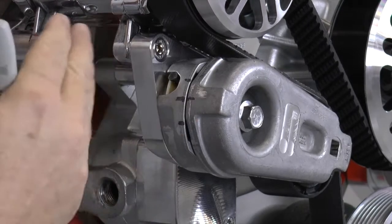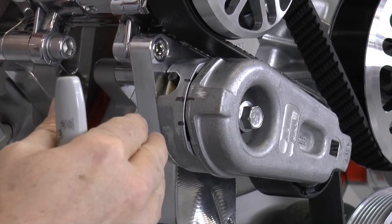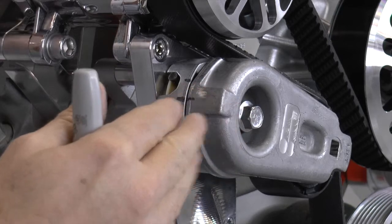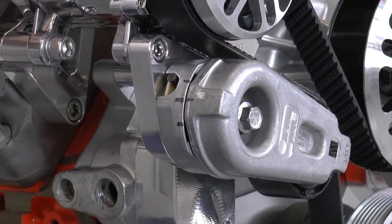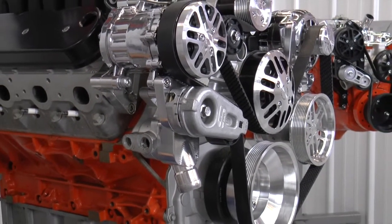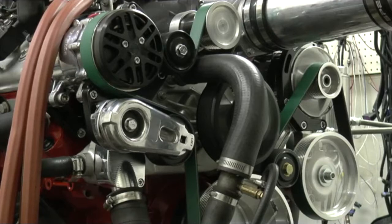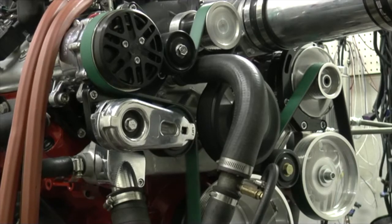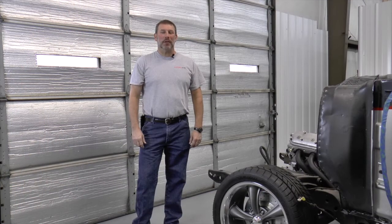A lot of times we are limited on belt sizes, so it's somewhat hit or miss. We try to furnish the correct belt and the one that fits best, but if you've ever messed with them much, you'll see that belts can vary — even the same two sizes could be a little bit different in length. So pay attention to that. We're also going to have a video of a 427 LS engine with a Heartbeat supercharger, and I want you to watch the tensioner move as that thing goes up through the RPM range. Thanks for watching Concept One Shop Talk. We'll see you next time.